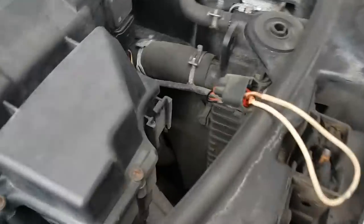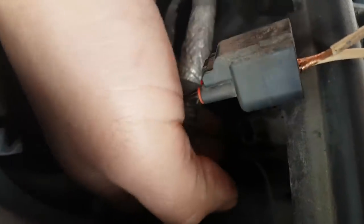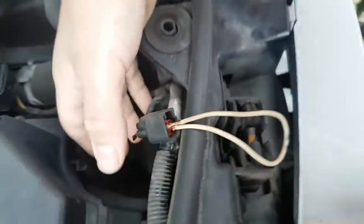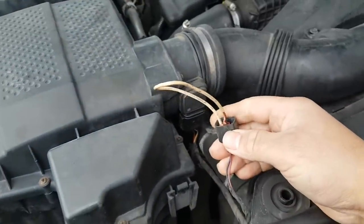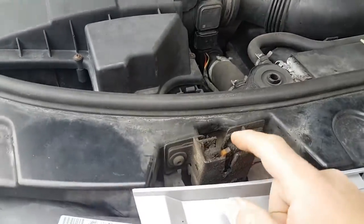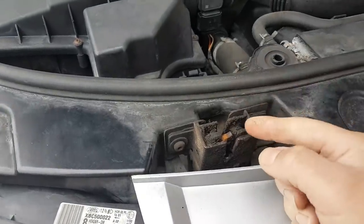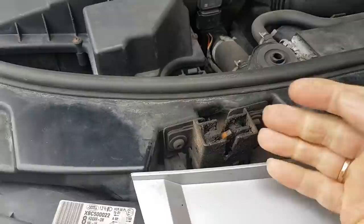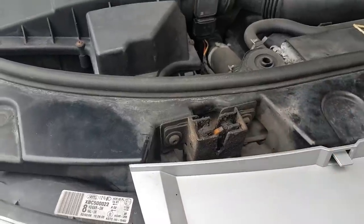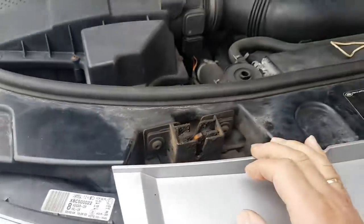So this is what I've done. The switch for the bonnet lives under this latch. It plugs right underneath there. There we go, that plug. So that's where it lives. This is the plug, and all I've done is short this, which means to me that when the bonnet is actually closing, the micro switch underneath is not latching or is not closing, and therefore carries on saying the bonnet is open. So with not much other options,